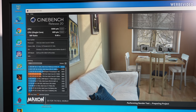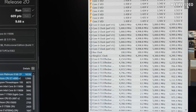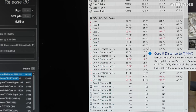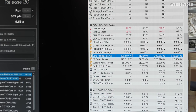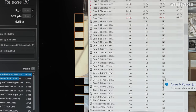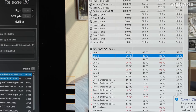Finally managed to get the overclock stable. Currently running 5GHz across all cores — not the greatest clocker. Measured V-Core on the mainboard is 1.38V under load and we're hitting temperatures between 80 and 90 degrees Celsius, which is surprisingly acceptable considering 1.38V. That is more voltage than you'd need on a 10900K with 10 cores. CPU package power draw is 300W under load — pretty insane — but considering that power consumption I'm okay with those temperatures. That should be our baseline.